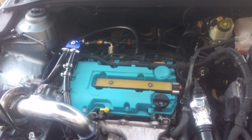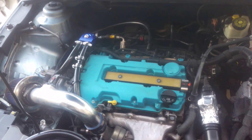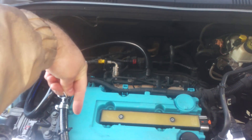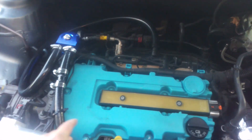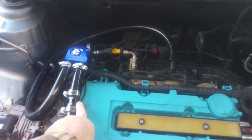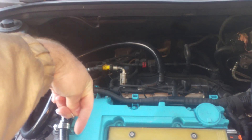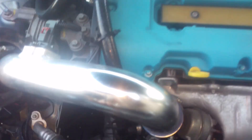You may notice a check engine light with a code P1101. It'll be surging at idle and light cruising, but when you're under boost it'll smooth out, because under boost the air actually flows the opposite direction. So this one-way valve will keep air from being sucked in at idle and light cruising, but still allow air to flow to the turbo under boost.